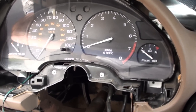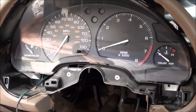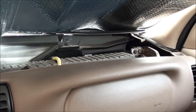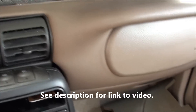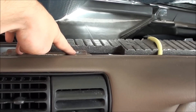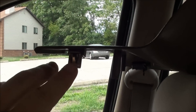Now it's daylight. I am going to remove the instrument panel. I have already taken everything apart. There is another video on YouTube that shows you the instructions on removing everything, but real quickly: to remove this plastic piece, there are two 7mm screws that hold them on and then you just have to pop it off. There are these little clips right here — just be careful. I've already broken one off, so these do get brittle over time.